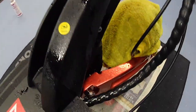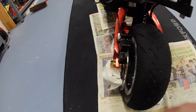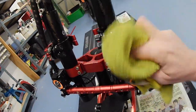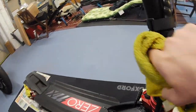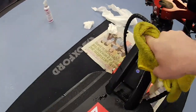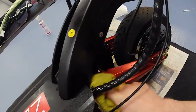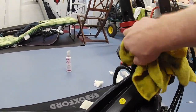The scooter's now got a liberal dosing — you can see it is pretty liberal, pretty much everywhere. Then what I recommend is just taking the cloths off the wheels and using the same cloth to start buffing off all the areas you've sprayed. Work your way all around ensuring there are no big droplets of the preventative sitting anywhere on the scooter. There's a little bit on the deck — don't worry too much, but just make sure it's not completely covered since this is your platform to stand on and you don't want it getting too slippery. Turn the steering round, get into all the bolt holes, and just keep working it in.